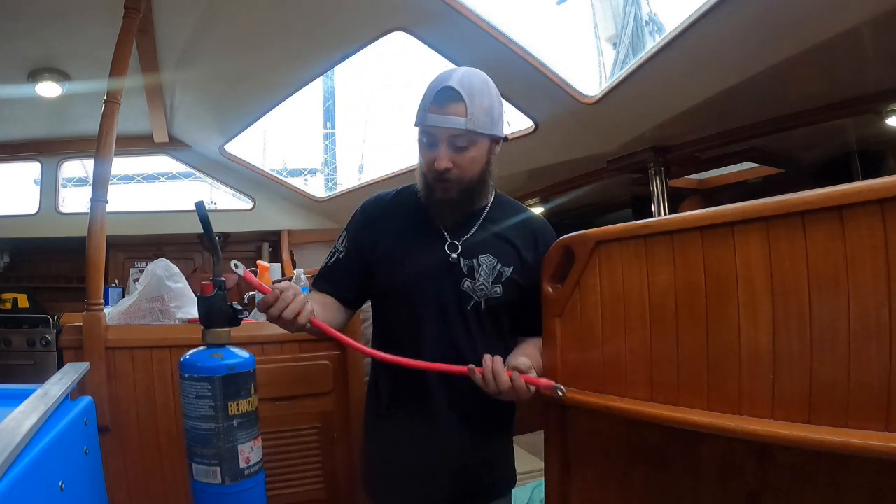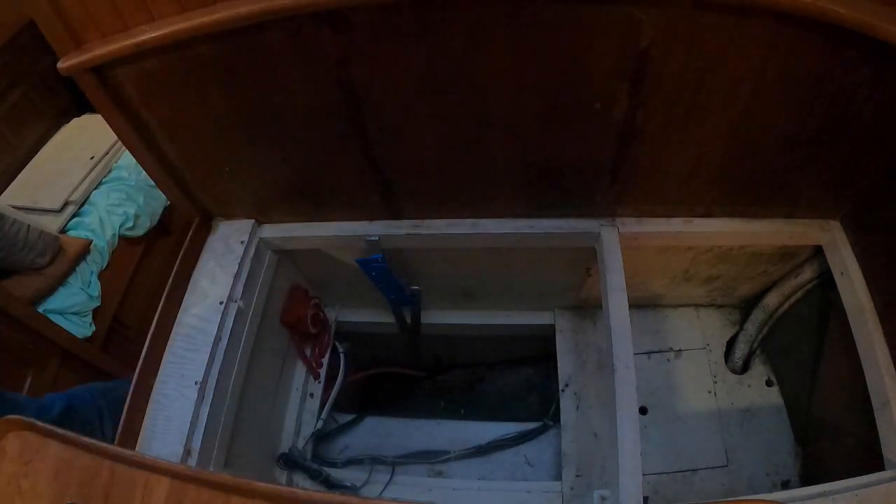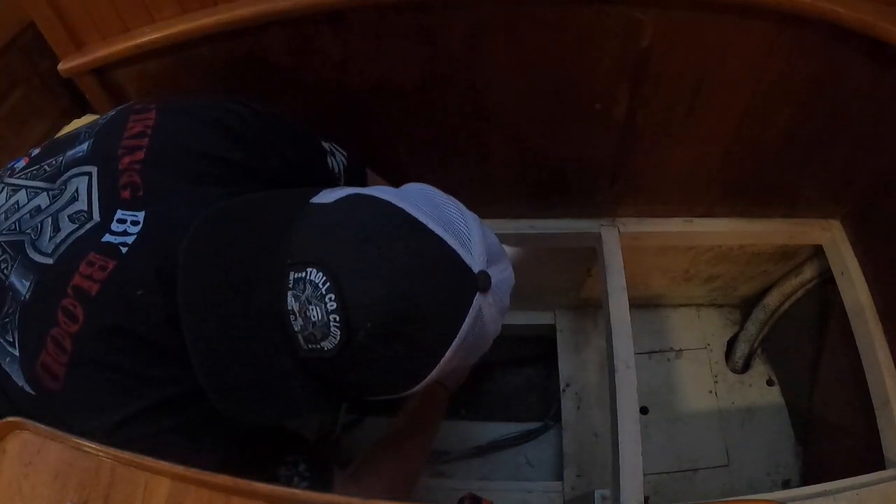Going to end up with a longer cable and just get this thing put in. As you can see, when we went to set up the inverter, it didn't line up just right with keeping it below this seat cover. So just took some aluminum straps here and we're going to hang it here with threaded holes down here. This will be nice because, like I talked about earlier, these things build a lot of heat. There's actually a certain distance around the inverter you want to keep it air-gapped, so this will give it an air gap behind it as well.